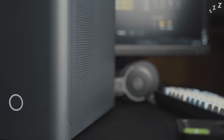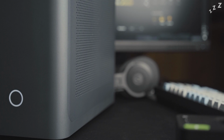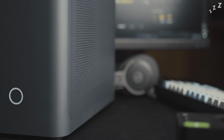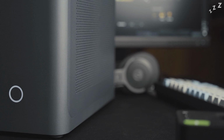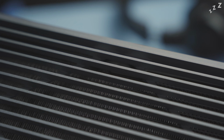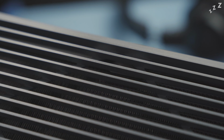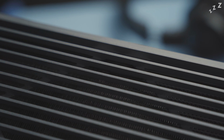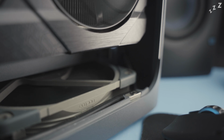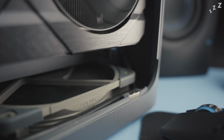As I'm sure you guys are aware, the IQUNIX ZX-1 is a sandwich style layout, and in general I would say the sandwich cases do get a little bit of a reputation for running hotter than other designs, but I'm not sure it's always deserved. If you're asking me what I think the best setup for this case would be, I would tell you that it's two fans up at the top of the case underneath the radiator, pulling in fresh air, and then hot air being exhausted through the bottom of the case by a fan mounted underneath the power supply.